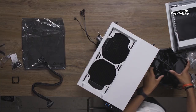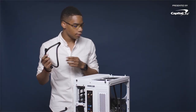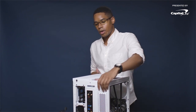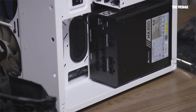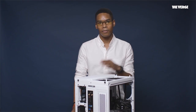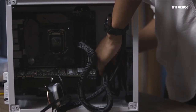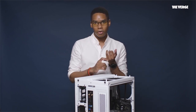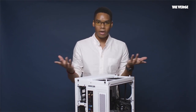Next up, cables. Every power supply is going to come with a big bag of velcro cables — it's kind of daunting at first, so you always have to find the ones that are going to fit. You usually get this big bag of cables when you have a modular PSU, and you need to match those cables with the correct descriptions on the power supply. Next step is connecting the power supply to the motherboard with the 24-pin cable — just matching that cable from the motherboard, threading it through the back, and attaching the 24-pin header to the power supply. The next few additions will be for the GPU, any specific ports the case has, any lighting, the CPU cooler, and anything else.